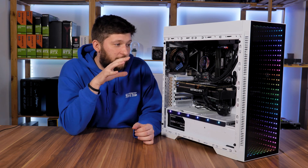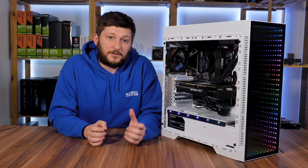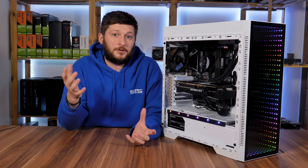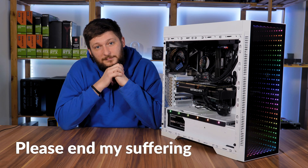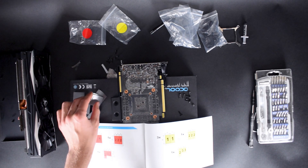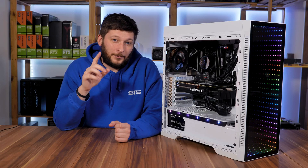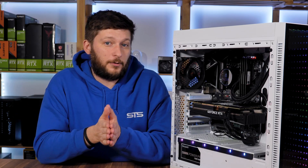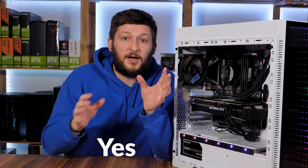But that's not even the reason why this is sucking the life out of me. It's this goddamn GPU, and it's probably even my own fault. Back when I got this card, the first thing I did was install an Alphacool water block on it. Fast forward two years — I took it apart, reinstalled the original air cooler, and now it's rendering the exact video I used to talk about. There's a slight possibility that when I installed the Alphacool water block, I miscut one of the thermal pads and was forced to use one of the original ones. This could theoretically result in a slightly compressed pad that doesn't make enough contact now. Maybe that happened, maybe it's a broken fan controller — we will never know. I'm not here to point fingers at anybody, probably because the only one I could point to is myself. But I want to solve this.